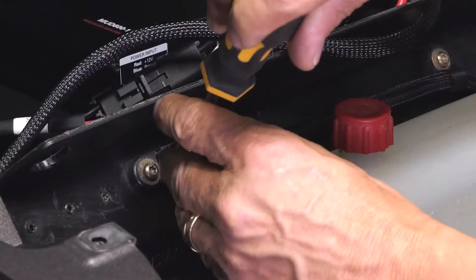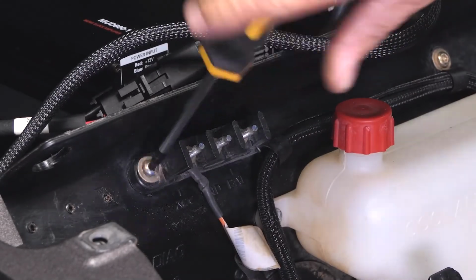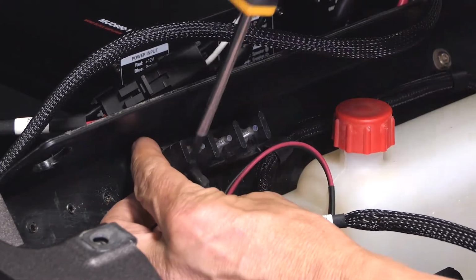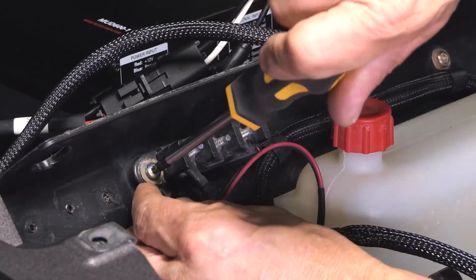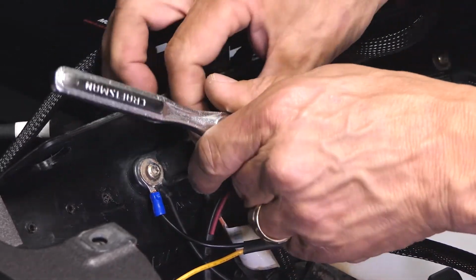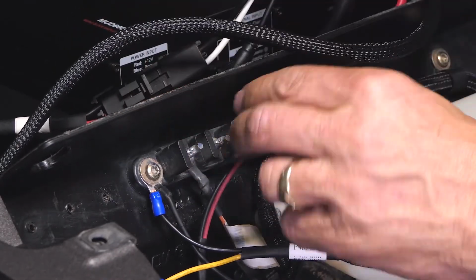With our battery connections made, it's time to move out under the hood area. In this particular vehicle, there are no accessory power and ground wires run from the battery. In this instance, we're going to use one of the T25 Torx on either side of the bus bar as our ground point. The accessory is still present, so we'll go ahead and use that as well.